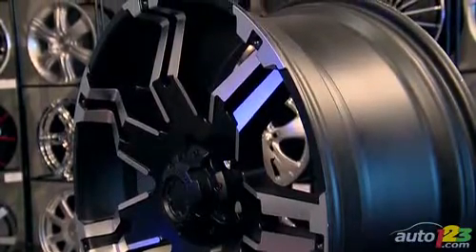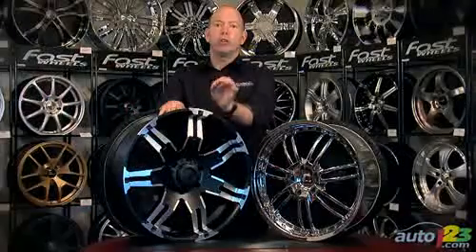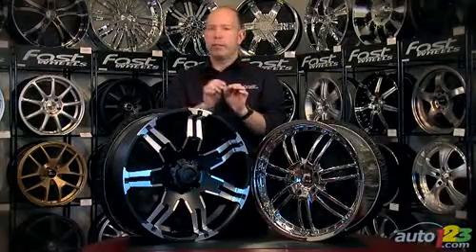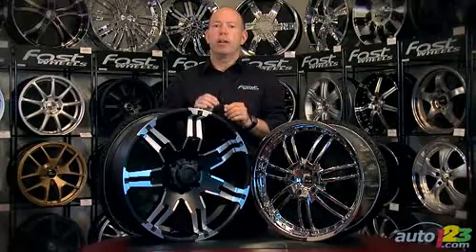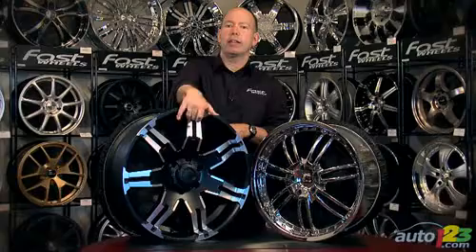So you want to get out and have a look at them every so often to make sure that you don't have a big section of the clear missing. Whenever you do, you want to touch that up with a little bit of clear nail polish or some other type of clear lacquer, in order to make sure that the contaminants don't get underneath and start attacking the aluminum finish.